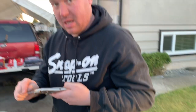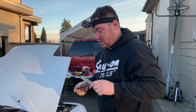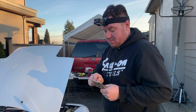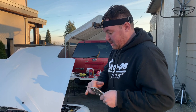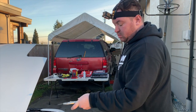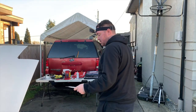So to get the easy out out of the hole, you just need to rotate it in the opposite direction and it releases its hold. I was able to get this out with a pair of vice grips. Because it's hardened steel, the vice grips were just slipping. I really had to overtighten them to clamp onto the easy out to get the broken tool out of that hole. But now we can drill out that hole to a workable size for the M6x1 tap and see if we can retain the original thread hole on this side, unlike the other side.